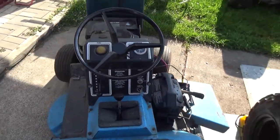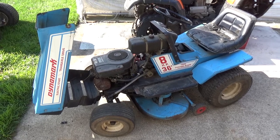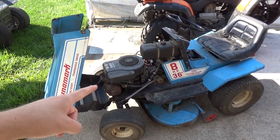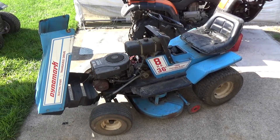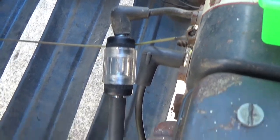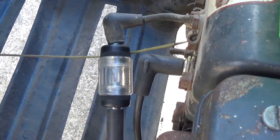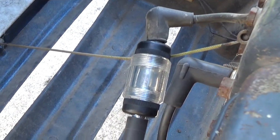With the Eliminator turned on, I gave the key a turn — and it turns over. So we know the starting circuit is good. Now we'll go ahead and check for spark. I'll get my spark tester, hook it up to the high tension lead — one end into the high tension lead, the other end from the spark tester onto the spark plug — and turn the key to see if we've got spark.